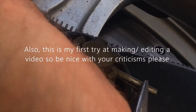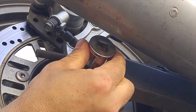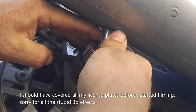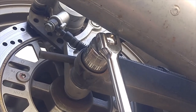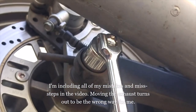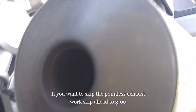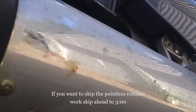I'm going to straighten this out as much as I can. Trying to get a wrench in here — not quite sure how other people are doing this without moving the exhaust a little. Well, I guess that got on there, just bumping into the exhaust here. I might loosen this exhaust up, try a different angle maybe — just running right into it. Looks like there's a bolt up here so I'm going to try and pull that and see if I can get any movement out of the exhaust to get it out of the way a little bit.